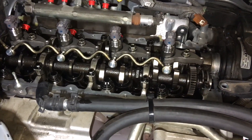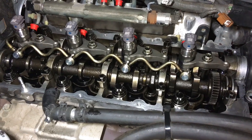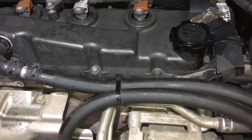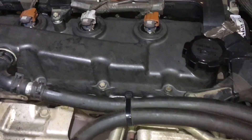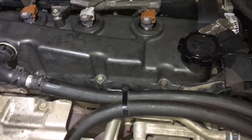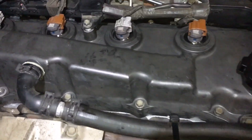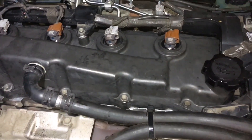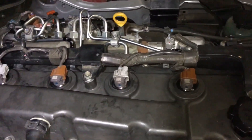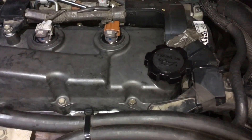We haven't torqued it down yet. We're about to put the valve cover on, check the alignment, make sure it's all good at the nozzles. Over this side the engine's pretty well coming back together. You can see the hoses that connect down to the catch can — personal choice if you want a catch can, but it didn't look like it was working too well by the amount of oil in there. When it blocks up, the whole crankcase ventilation system fails. We also did a little repair on that bit of broken plastic at the front.